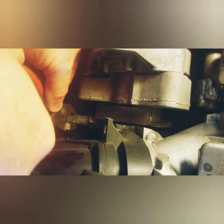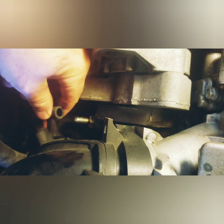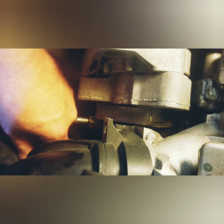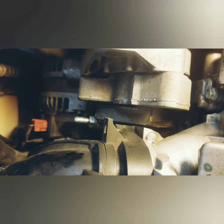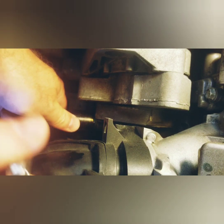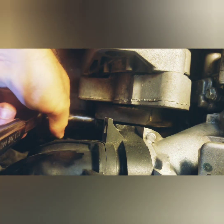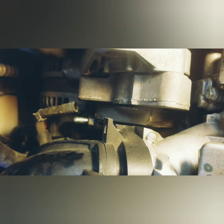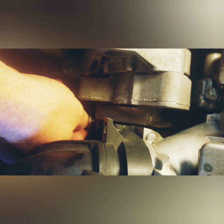Then you can take just your regular spare pliers, clasp on that, and pull it back to a safe distance. Don't ever just grab and tug on one of these — kind of just work it side to side. You can rip them, and you've got a little bit of forgiveness there, but if you rip or tear one up you can cut it a bit. Just take the rubber hose and put it out of your way. You can see the PCV valve right there. Get the 17 millimeter ratchet with my 3/8 and put it on there. On the Honda it screws directly in.